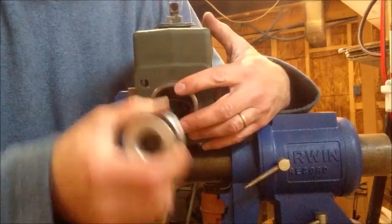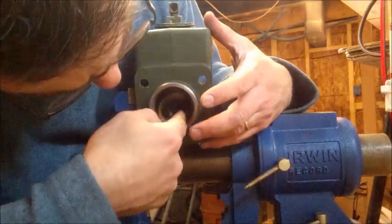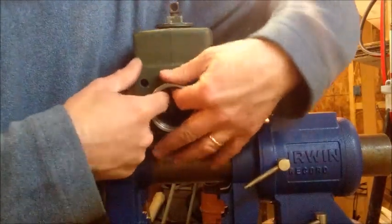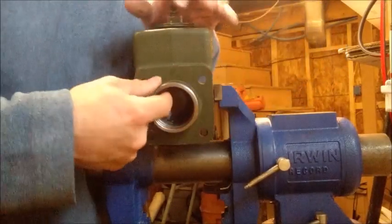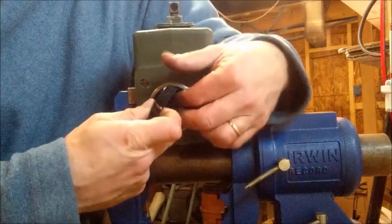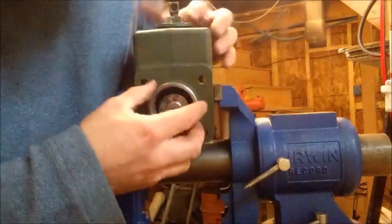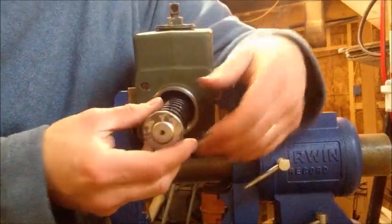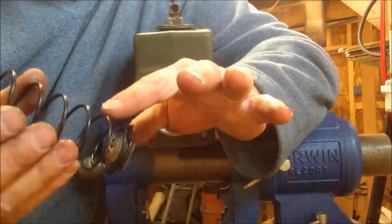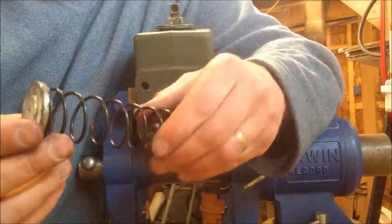Now this plunger — that's your plunger with a little rubber guide on there for sealing it. We've got a brass flex washer. And down in here is another plunger that's got a rubber boot on it with a spring behind it. Sometimes they don't want to always pop right out, but you play with it a little bit and it'll come. The spring is actually comprised of three parts: this top plate which comes separate, the spring itself, and then this bottom plate which also comes separate. The hardest part is the top plate that has two clips on it — that can be kind of a pain to get back on the spring.